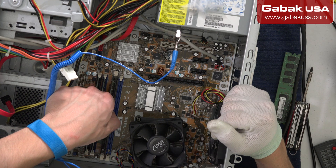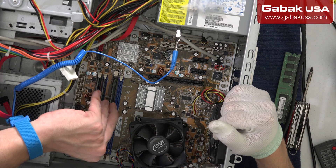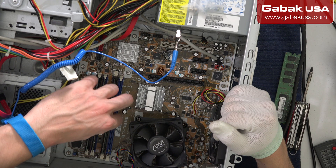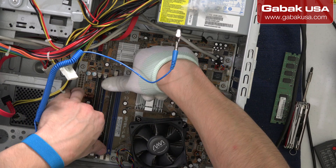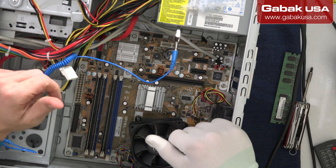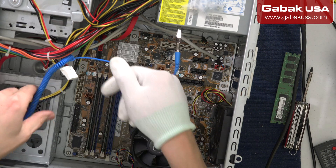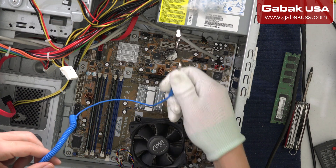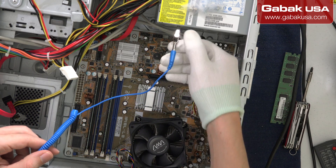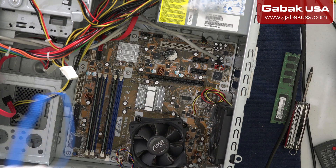That is all you have to know in order to install the RAM properly and not have any issues. Remember: when you are going to install the RAM, make sure the notch fits its place. Push on one side and the other side at the same time, and you are set. Connect everything back and everything should work just fine. If you have to leave the computer for some reason, you can just unplug the wristband like that and then plug it back. Once you finish, open the alligator clip and basically that's it.